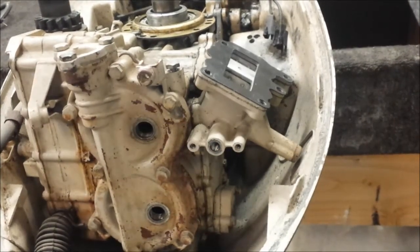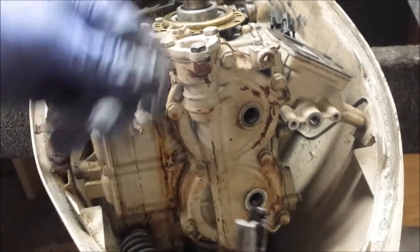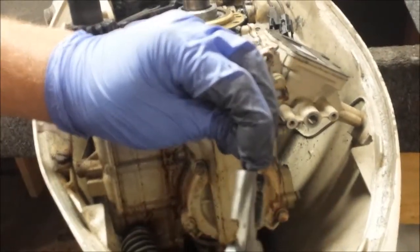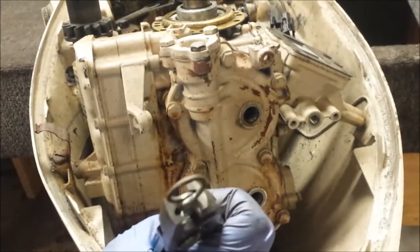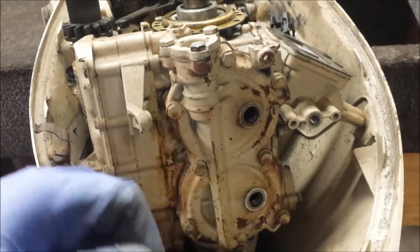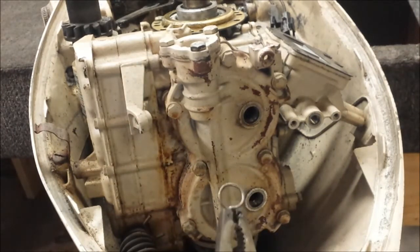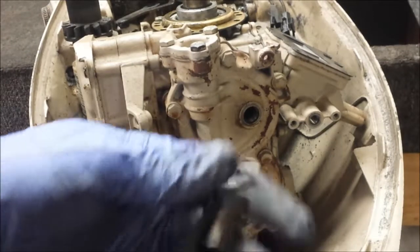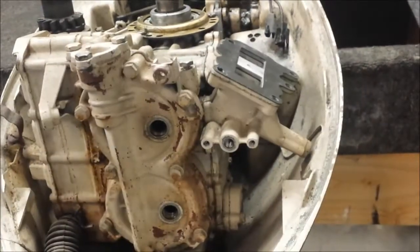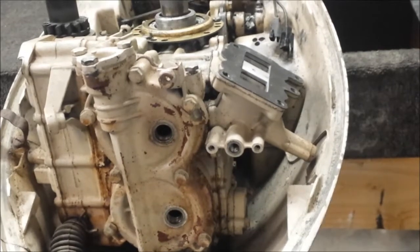That's how to remove the carburetor. I'll show you these hose clamp pliers again — it's the slot that lines up with that, so it fits in like so, holds it, and spreads it. Pretty handy. I like reusing these because obviously they lasted this long, they're going to last a while. And they're not stupid looking, I don't think. I don't really like traditional hose clamps — the little screw ones. I like these spring clamps a lot better. You don't see them as often, but you do on some things. So I'll probably get the starter off next.